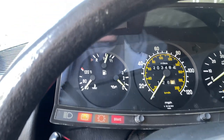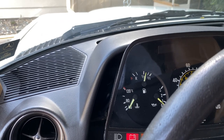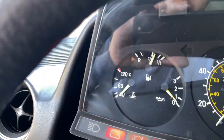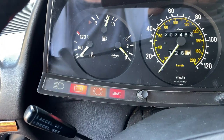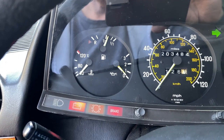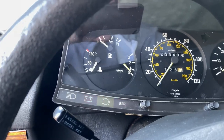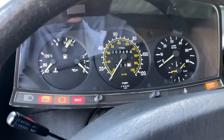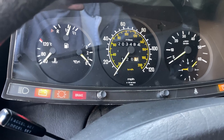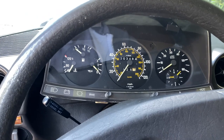My first test was to put the electrical connections back and just see if I was getting the same fluctuation. I was very happy to see that when I turned on the lights, the gauges were rock steady. And when I used the turn signal, they didn't move at all. I double-checked to make sure all of the pins in the connector were pointing at the right bulbs and all the myriad things that connector connects to. Once I was satisfied with that, I put the car back together and took it for a drive.